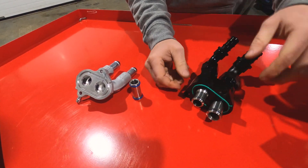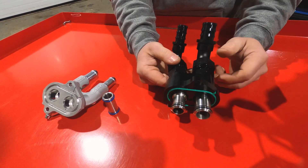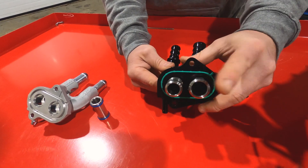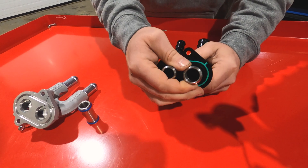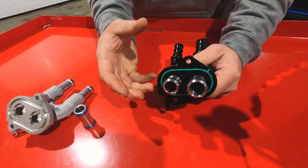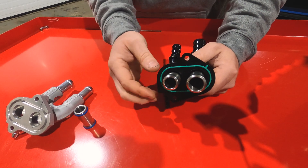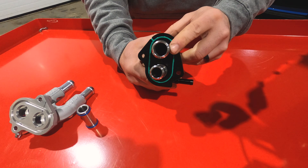You can see the difference in sizing between the stock core and the Whipple core. Obviously, if you're all about flow, the Whipple core is going to be the way to go. These fittings are stainless steel — there are some other adapters out there with aluminum adapter fittings that don't expand and contract properly, so the aluminum can cause issues and leak slightly past the o-ring seals.